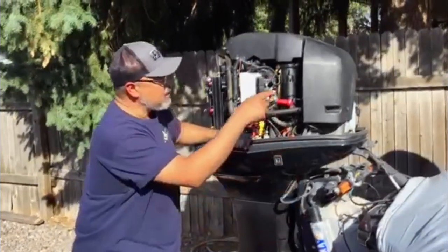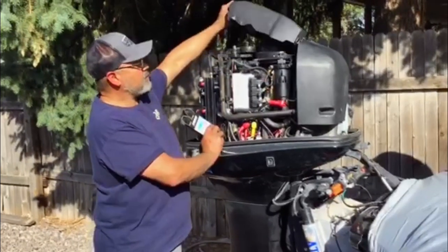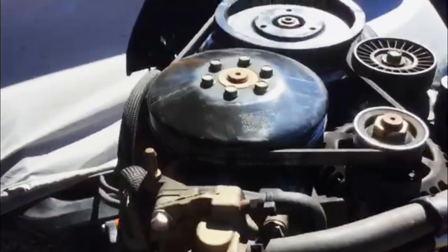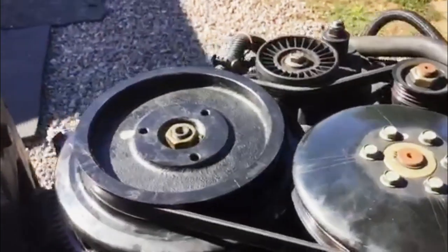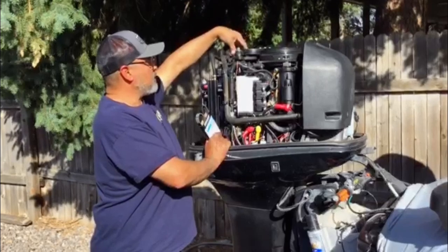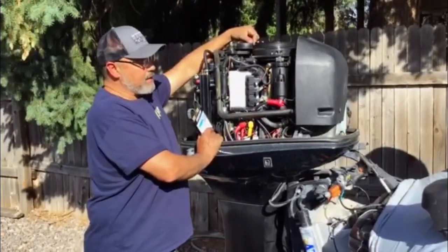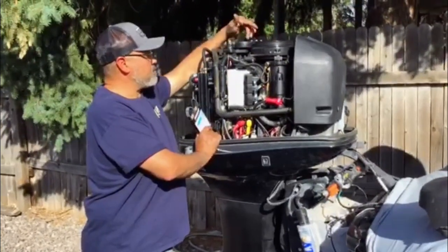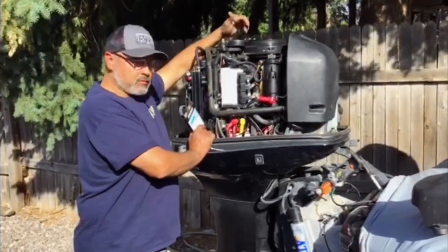What you have to do is take your cowl off and then take your protective cover off. You inspect the belt to see if you've got any types of cracks or anything, and that's a big deal because this belt drives your crank, your alternator, and also your air pump. If this belt was to break or wear down, you're going to have some performance problems.